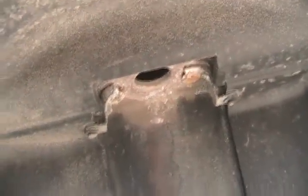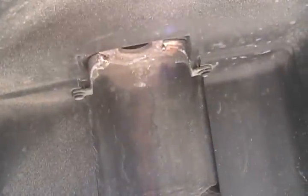So you can see more of it under there. I've removed the strut that went there and there's still little bits of that part left up there. All the top strut mount plates corrode off on these cars by electrolysis.